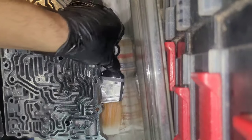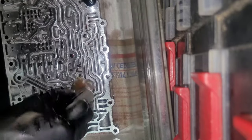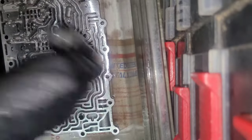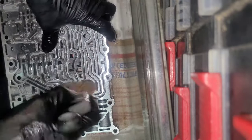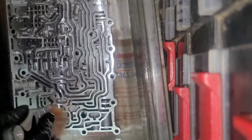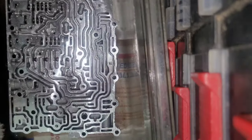Okay. Rub the bores. Take your soft bristled hand brush. Get everything moving around in there so that you get a good rinse and air dry with the air compressor. If you don't get some fluid in there and you don't stir it around, the mineral spirits might not come out.